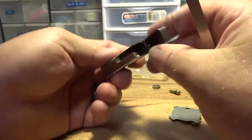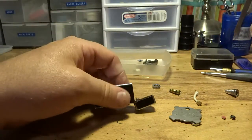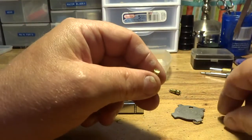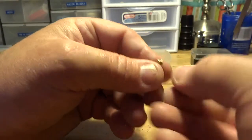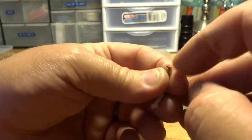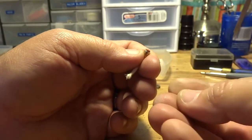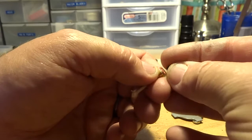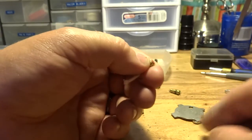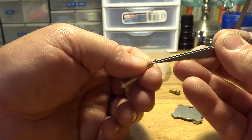Anyway, this lighter now is completely disassembled. Alright? Now, what you want to do is, this assembly right here on this lighter, these filters are usually gummed up on these lighters right here, okay? I mean to the point to where this top valve assembly is stuck. So you'll just have to pry this off. You don't have to get in this area. You don't have to dig out all the crud